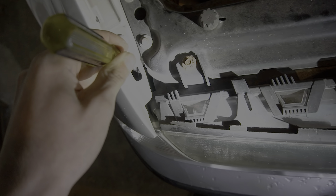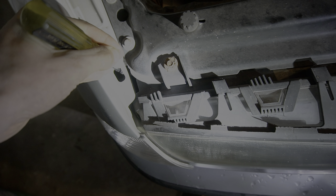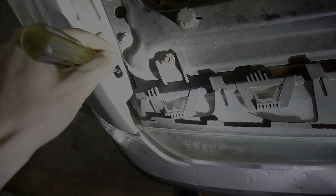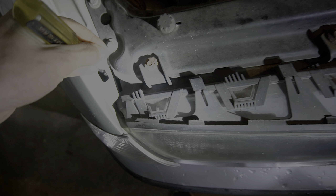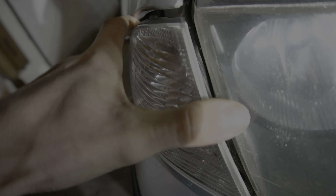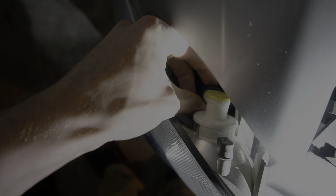The clip is right in the middle and you'll feel it. What you do is push it down and push forward like this — you want to do it one or two times just to get it fully out of there. Hold that, and then take the light. Don't pull it all the way out because you have to unhook the inside by pushing down at the top of the clip until you hear the click, then pushing down — and it's out.